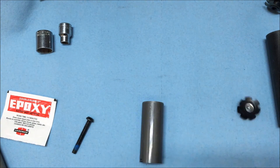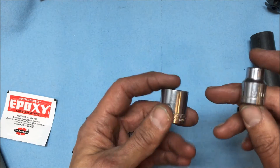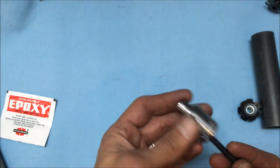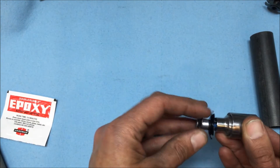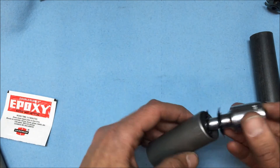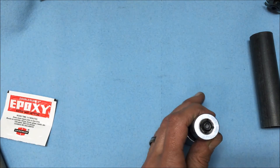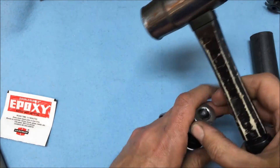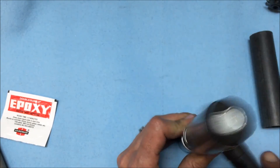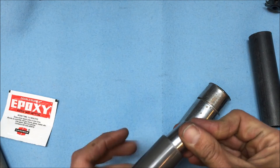If you're doing this in your garage and don't have that tool — before there was actually a dedicated tool when the headset system first came out — I would just use a longer bolt and stack a couple of sockets together that'll fit inside. Use that as a guide, try to hold it as straight as you can. It takes patience; I've got it started a little crooked here, but you work it and straighten it out as you go, and smack it in about a half inch.